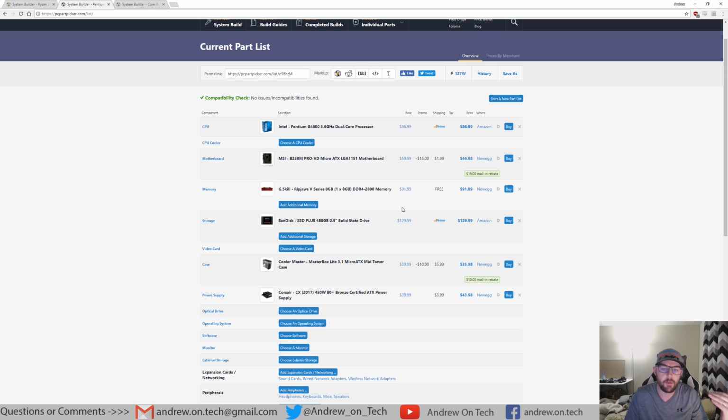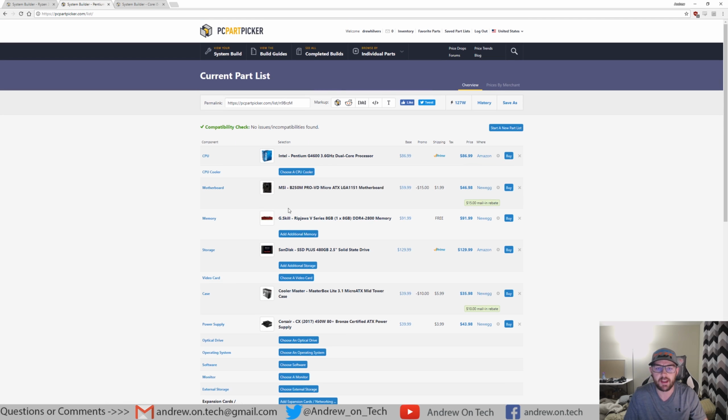But again, if you're building a computer for somebody older, you don't want to overclock, you don't want to do anything crazy like that. You just want something that's a standard build with maybe a little bit of runway in the future. So I gave them that runway with the one 8GB stick, so you could add another one in the future. And number two, I went with the all SSD storage option. They don't need more than 480 gigabytes. They're not storing movies or games or anything like that. That's going to give them a really, really snappy experience in the operating system, which I think is probably the most important thing for them. So that's where I went with that case.